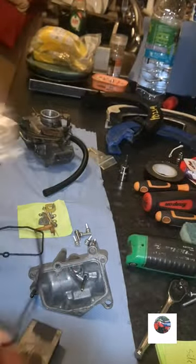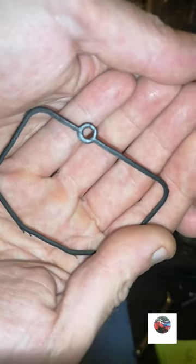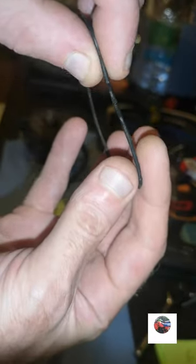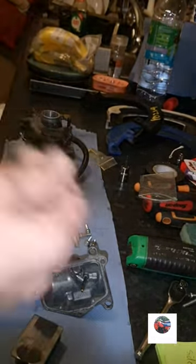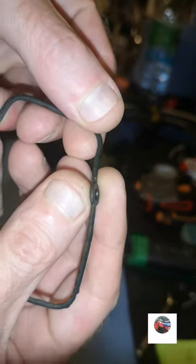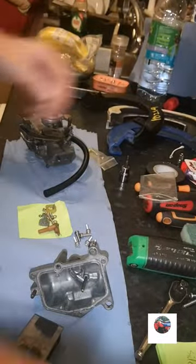New bottom gaskets from the day. I was going to keep that one, but as you can see, it's all flat on this edge. There'd be bits in this video I've showed before, but we've had that many videos and it's took us four days to do it, waiting for the head gasket, the exhaust gasket, and this carb seal. You sometimes forget what you've put, but anyway, you can see the flatness there. See there, look. But I'm going to put a new one in. Just saves taking the carb back off and putting it on. But there's the new one.